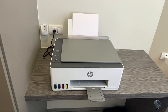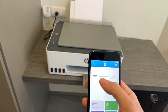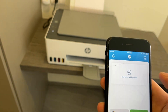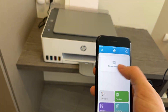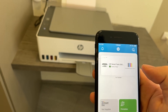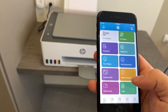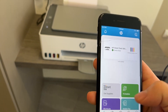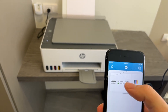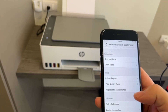We're going to show you how to do both of those in this video. First of all, go onto the HP Smart App. If you've logged in already and you're connected, it should come up here with your printer. If you're receiving a setup or add printer symbol instead, you'll just need to go through those steps and connect it — check out that other video on how to do that. Once you've done it, it will come up with a supply level check on the ink cartridge and a few more options to print, scan, or do a copy. Now what we're going to be focusing on is the settings. Click on HP Smart Tank and go down to the tools section, then to the alignment and maintenance category.